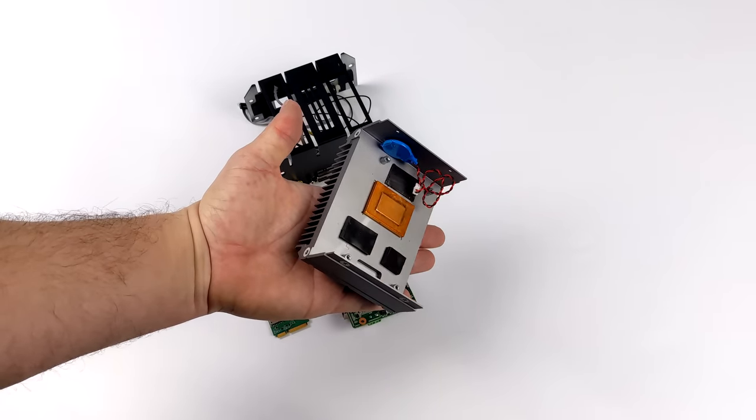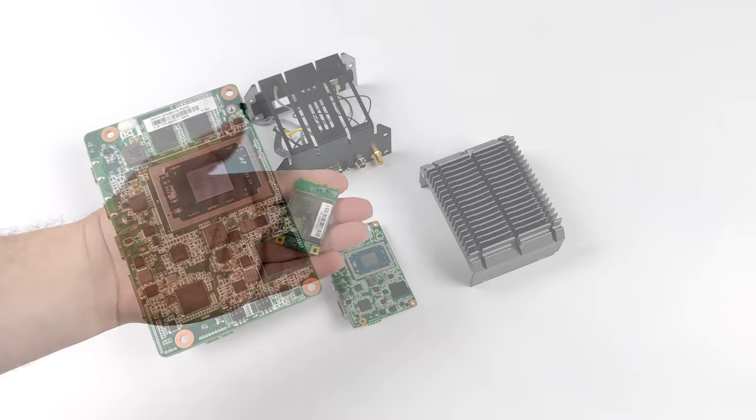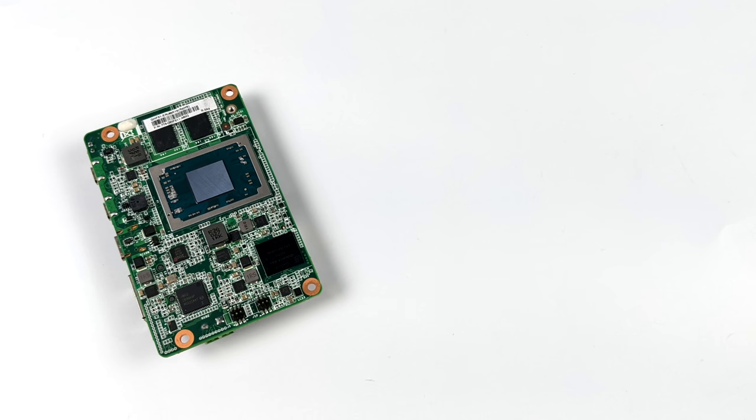I've run some really hardcore tests on this thing, and the highest temperatures I've seen was 81 degrees Celsius, and this thing thermal throttles at 87. For the CPU — or the APU — we have the AMD Ryzen Embedded R1606G: two cores, four threads, base clock of 2.6GHz with a boost up to 3.5GHz, built-in Radeon 3 graphics at 1200MHz. 4GB of LPDDR4 running at 2400MHz, 64GB of internal storage, though they do offer a 128GB model. It will run Linux or Windows — it came pre-installed with Windows 10 Enterprise, but I upgraded to Windows 10 Pro so we could do some gaming and install all the applications I wanted to test.